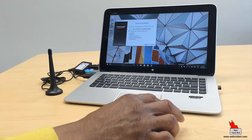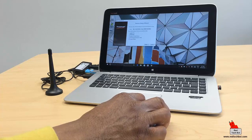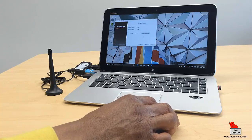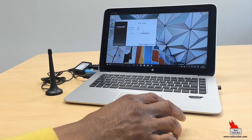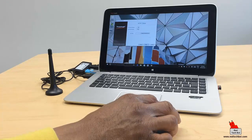Here's the device setup wizard running for the first time. I'm selecting to scan for digital ATSC channels — those are the free over-the-air digital channels. I'll leave the default scan settings, starting at channel 2 and ending at channel 69. If you have internet access, enter your zip code here so the software can use internet-assisted scan mode — it will know what channels are available in your area and speed up the scan. I'm leaving it blank to see what I pick up.